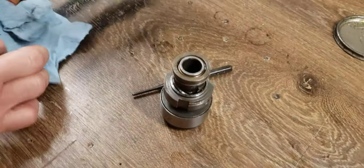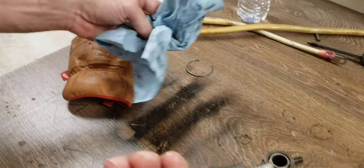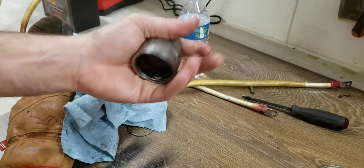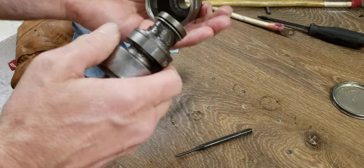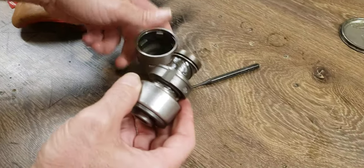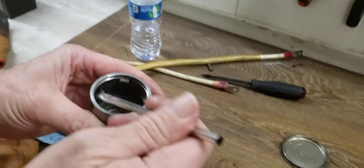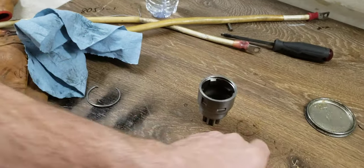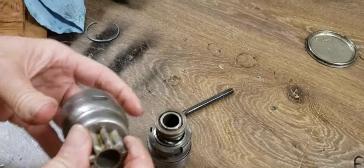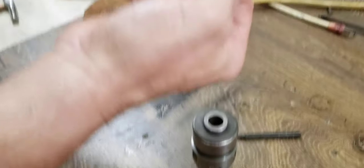The next step is to take the actual Bendix. They can make the starter into a lot of different types of starters. This is the head unit — you can buy a different head for this with different number of teeth and so on. They manufacture one starter and it can apply to a lot of different units. Look at how nice that goes on there. We don't need to grease that up really, but we'll put a little light layer just to prevent rust — just a little bit of a film, not so much for lubrication but for corrosion prevention.